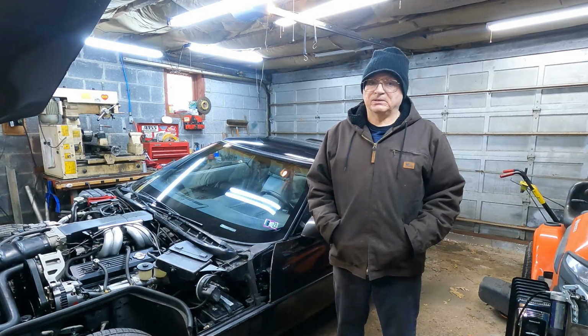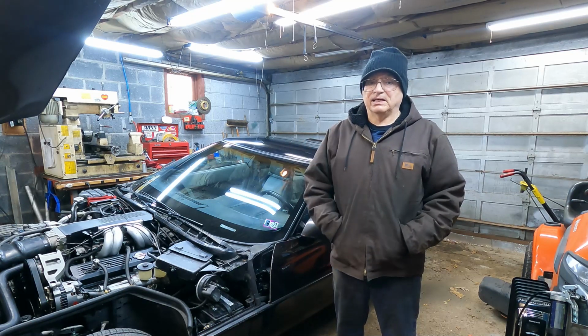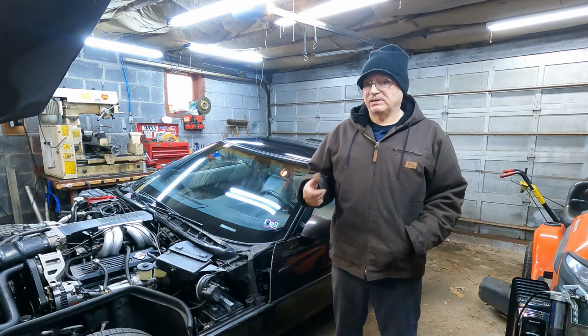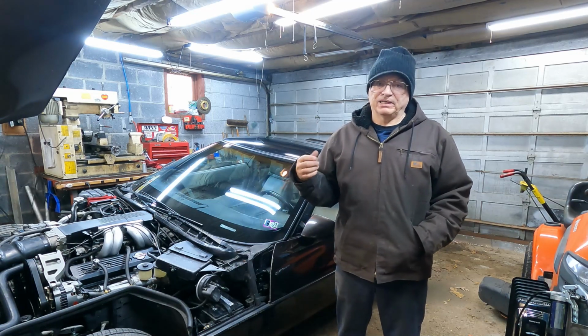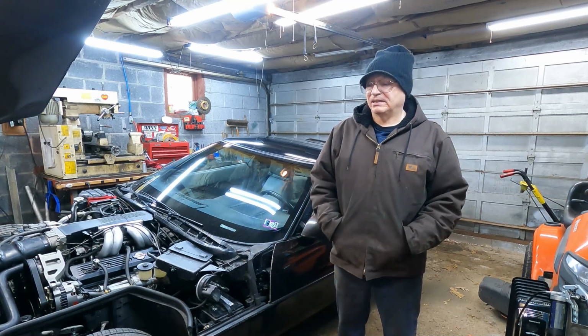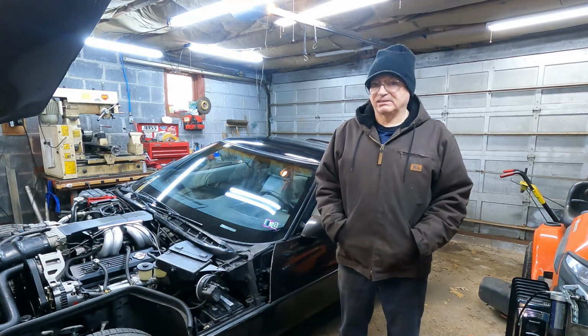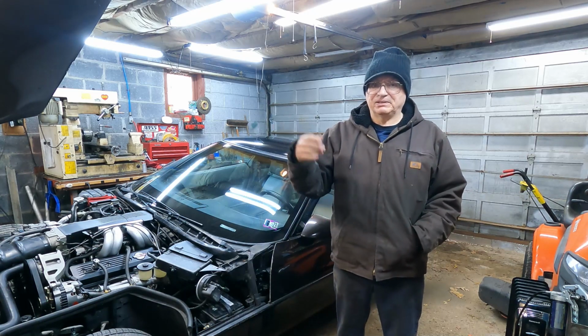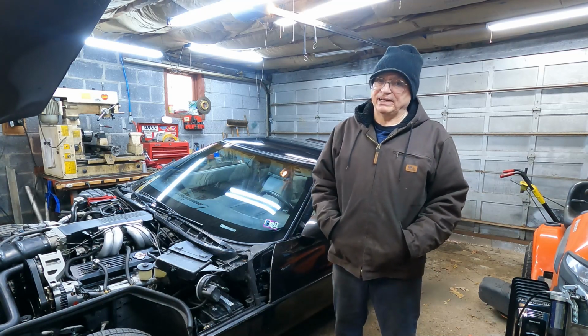Okay, with the old knock sensor just hooked up to the wire and dangling, I only got 2 to 4 knock counts when I started it up. First time starting up cold, I got 4. After I warmed it up and started it, I got 2 knock counts. That's about normal. Before it would get like 9 knock counts instantly, and if you ripped it up, it would go up to like 20 to 25. So I'm hoping that it's the knock sensor.